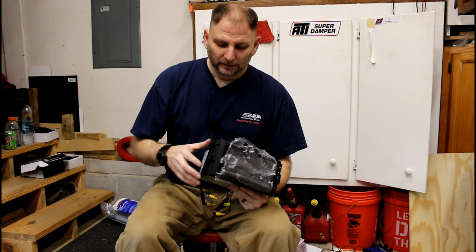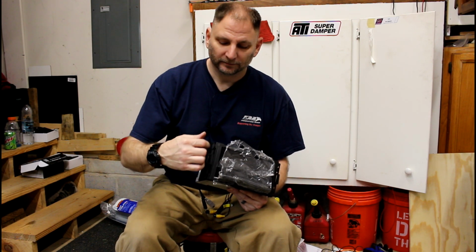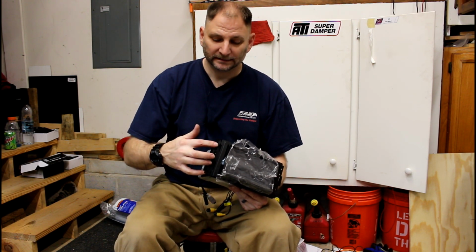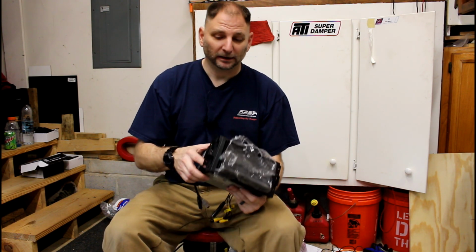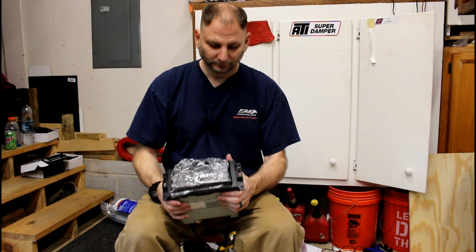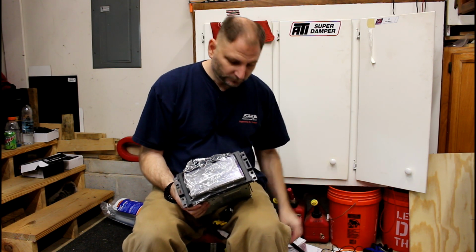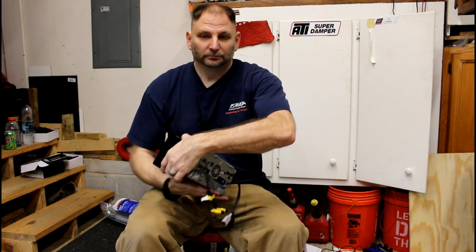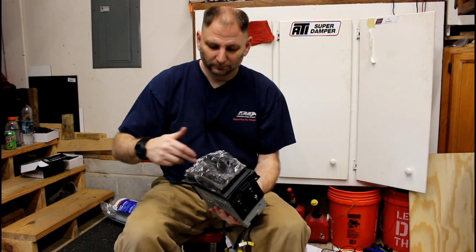On the radio, these two little plates mount inside this first bracket adapter. Then you screw it to the side of the radio with the supplied hardware. Then this second trim ring snaps down in, and you don't end up using the stereo's trim ring. Then this just slides right in, bolts right up.